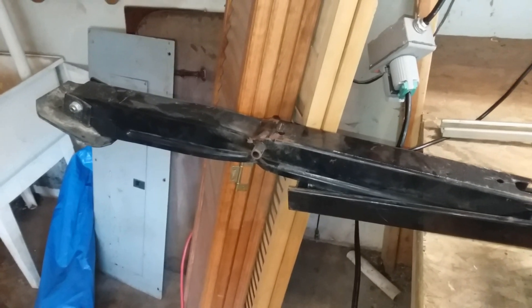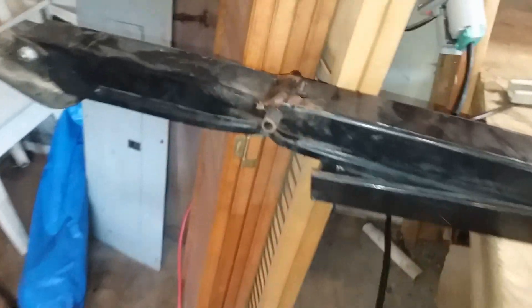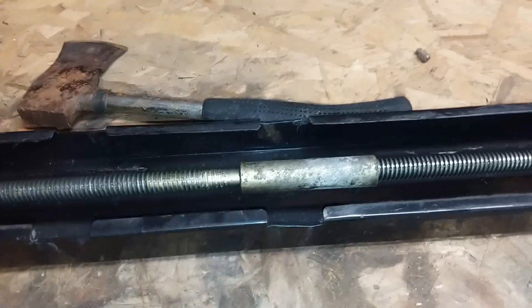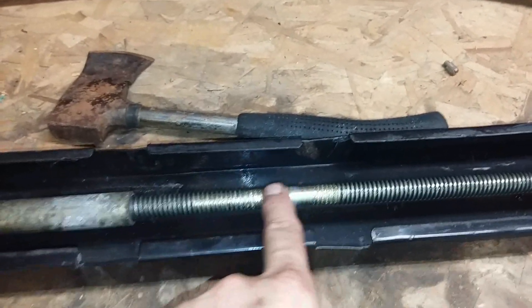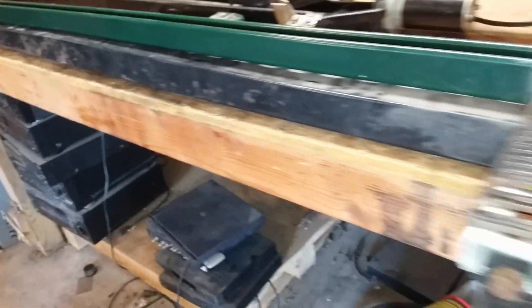This is the work I'm having to do on my Lippert stabilizer for my fifth wheel trailer. As you can see, it got a little crumpled here and actually ended up folding right in the center sections — it bent the center sprocket just a little bit out of alignment. But the worst thing to happen was that the main bracket got bent right in the middle from too much weight.